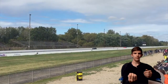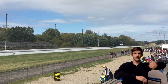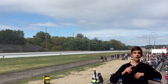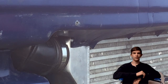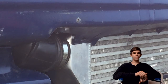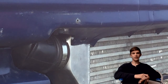The intake comes out pretty much straight down out of the turbo because of how it's oriented. I got a curve that goes about 90 degrees to the side, then does a 180 forward into the intercooler. I got rid of the wiper reservoir since it doesn't work and I've never used it — I just ripped it out and cut a hole with an angle grinder through where the reservoir was, then stuck the intercooler pipe straight up through.